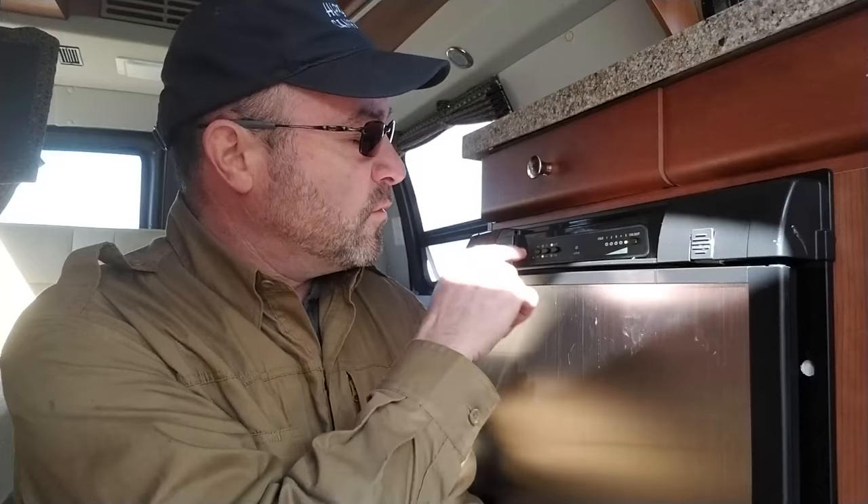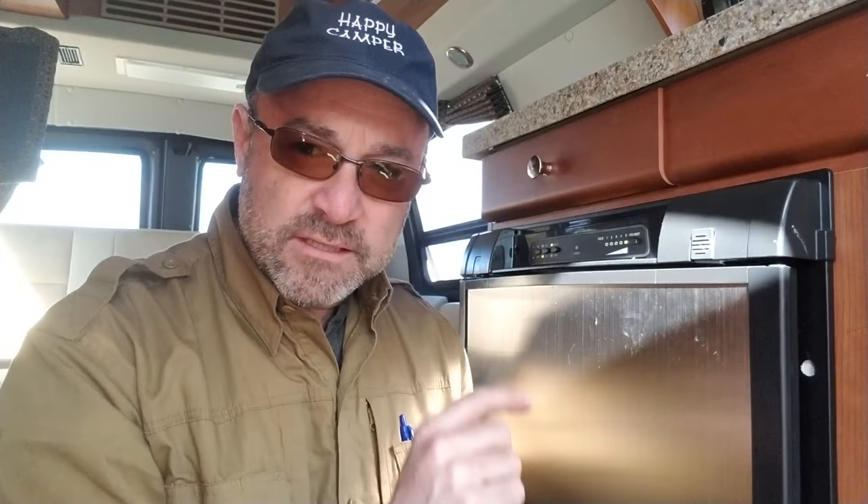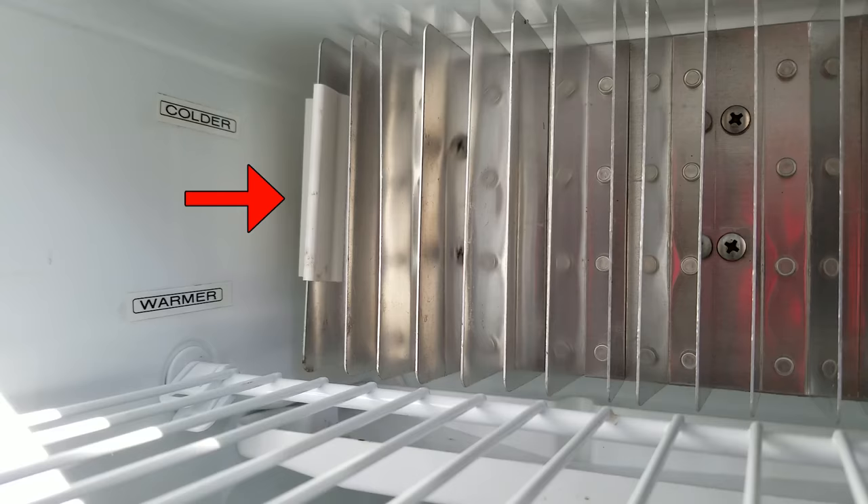Let's talk about these refrigerators. The customer states that it's getting too cold. This is a Dometic — we're in a class B RV, so this particular one is a smaller one, but it's going to work the same on your larger Dometic refrigerators. How do you adjust the temperature? Right here on the eyebrow board I see colder, warmer, one through five. That's only part of the equation. If we open up the door and show you inside, you're going to see the thermistor. Let me show you all the parts and explain how they work so you'll know how to adjust your refrigerator.